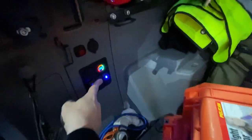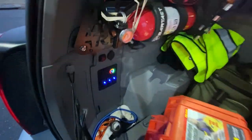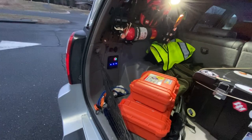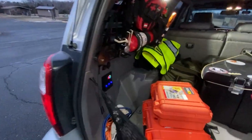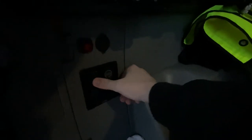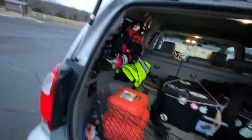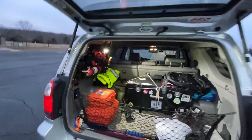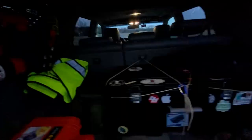I've also got a voltage meter back here — just to monitor things if I have a bunch of items plugged in or the lights running, making sure the battery doesn't get too low. Long term, I'd like to add a dual battery system and run all accessories off that instead of the starter battery so I never run it flat. There's also a USB charger back here tied to the switch — pretty nice for tailgating and camping, especially at night when it really lights up the cargo area more than the stock lighting options.